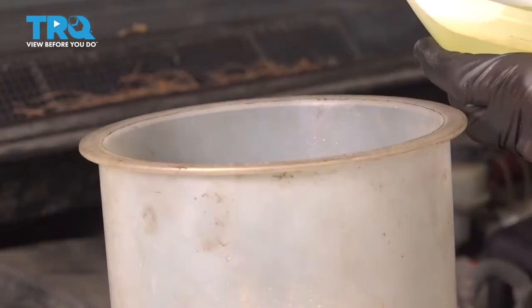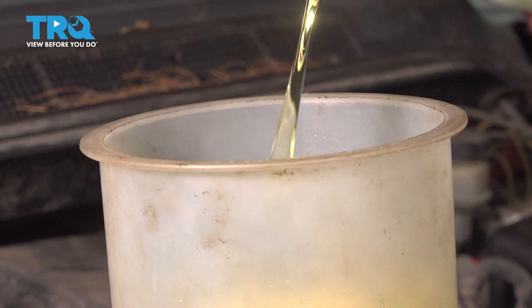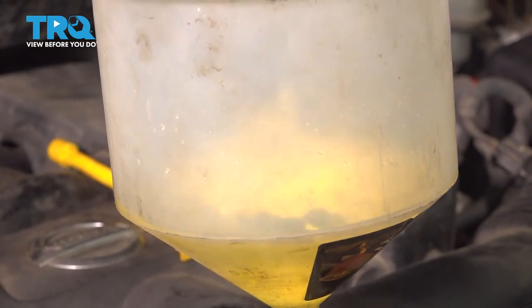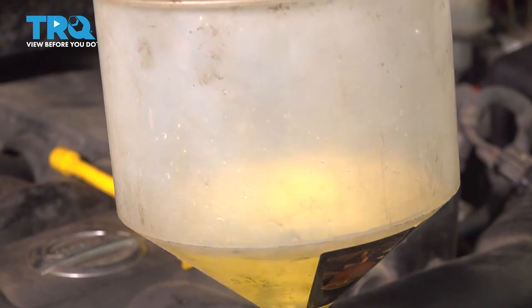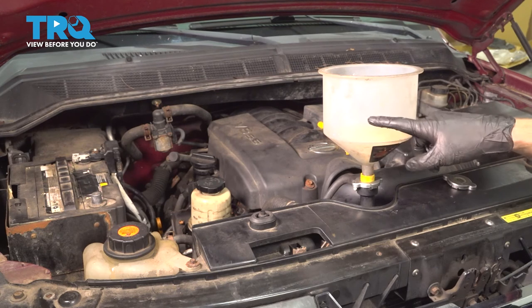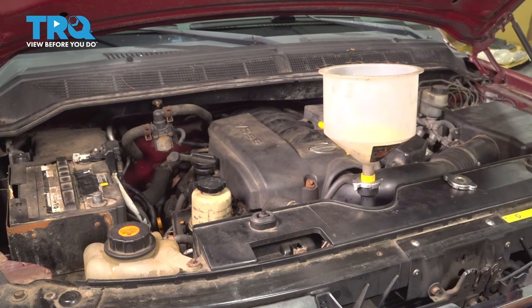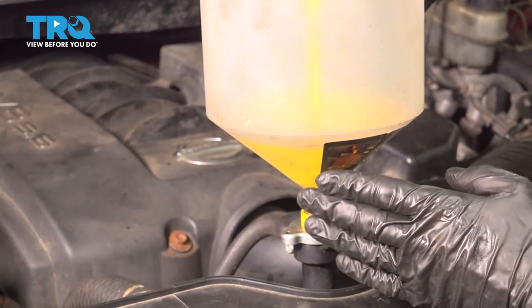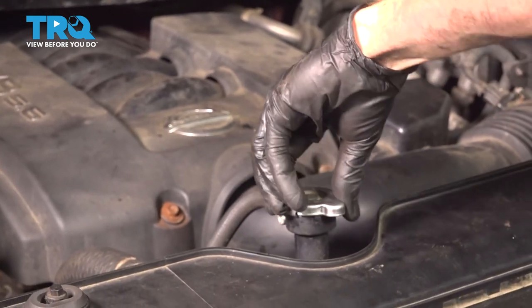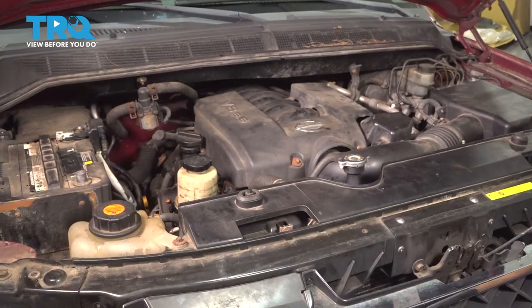Now close the overflow tank and move over to the radiator side. Continue filling with the coolant funnel up to the indicated point. Let it finish burping — once it finishes, make sure you have it approximately halfway. Start up the vehicle and let it run for a little while. Make sure you have plenty of heat coming out of the vents and double check that there's no more air burping out of the system. Once you're sure there's no air in the system, go ahead and cork it off. Remove the funnel system, continue on with the cap, and make sure it's nice and tight. At this point you can go ahead and take your vehicle for a road test. Make sure you've got plenty of heat coming out of the vents and double check to make sure you don't have any leaks.